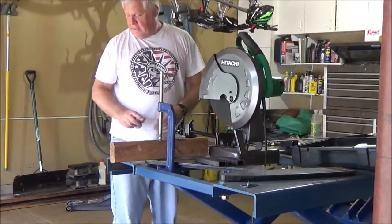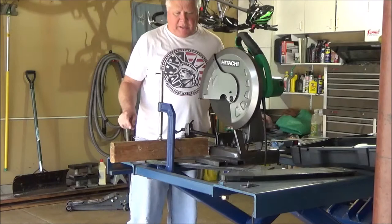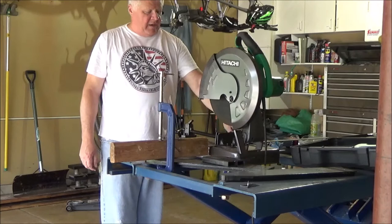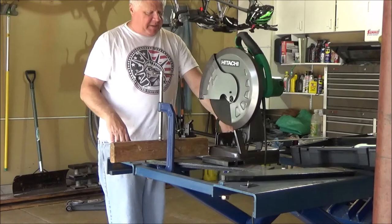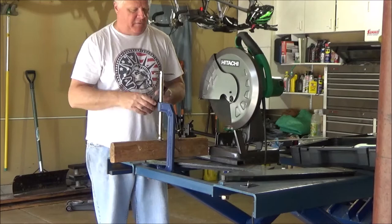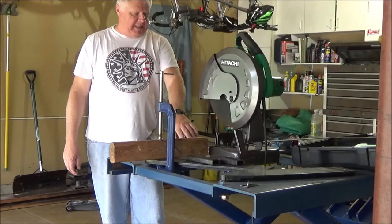Okay, so we got the band back on the bandsaw and finished the cuts of the 3/16 inch tubing, including the remnants cut down so that I can use them to dial in the welder. So now what I have is just some 1/8 flat stock. They didn't have 3/16 at Menards, and this will do. Basically, I just wanted to cap these ends. So I'm going to cut it to fill the opening, let the weld fill the 3/16. I need 8 of them. So I've got this set up just so I can cut 8 identical really fast. So here goes.